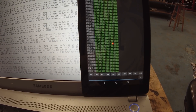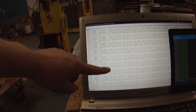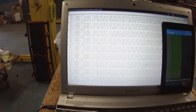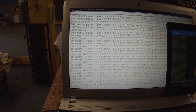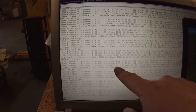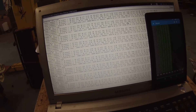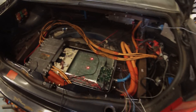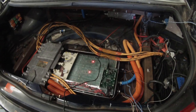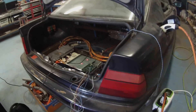On the Arduino serial link from the charger we've just got a USB cable giving us all kinds of data: AC voltage, AC current, DC voltage, DC current, temperatures, the cable current limit, the current limit from the PWM — all kinds of interesting info. This particular V1 board doesn't have a memory chip on it, so we can't save parameters. But the V2 and V3 boards do, so we'll be fitting a V3 board before we finally button up the charger.